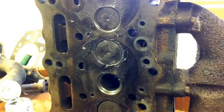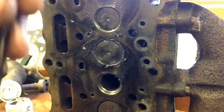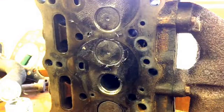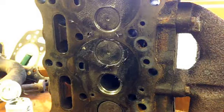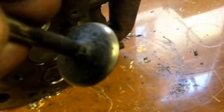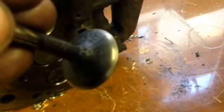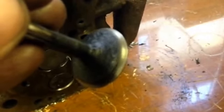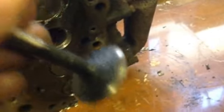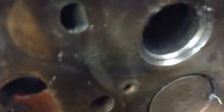Now this head has suffered some pretty serious water damage down the exhaust, and to be fair I may not be able to salvage it but I'm having a go. What we're looking for on the valves is dark spots, grey spots, and pits of corrosion. It should be a nice bright 3-4mm wide shiny face where the valve hits the seat. We also want to be looking on the valve seat itself for little pits, and you can see there's quite a lot on there.